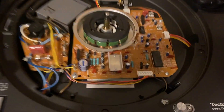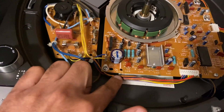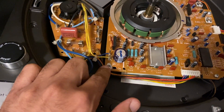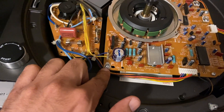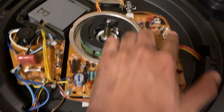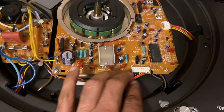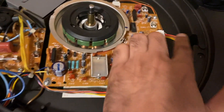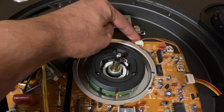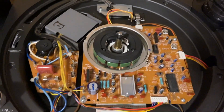You're going to get to the PCB, and from the PCB you're probably going to have a cable tie around this cable. You're going to want to snip that off in order to reveal this screw. There are three screws holding the board together — one, two, three. Pull those screws off, you need to unplug this connector here, the pitch fader connector there, and your lamp connector. It's just those three cables — pull those off.